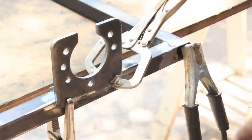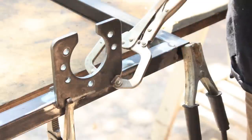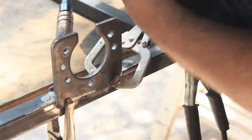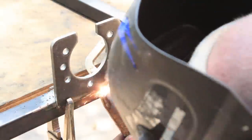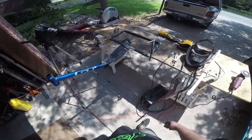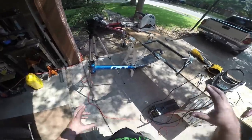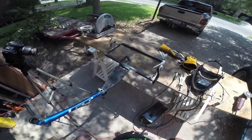Here we have this squared up as best we can with its center line. Because you're looking at something like this, make sure you draw this line across and leave space up here for this nut to sit — otherwise you won't be able to get the bottom bolt in. Now we're just going to tack this bad boy in and that should do it. Got all the surfaces cleaned up, got this straightened out and centered. There's our bicycle frame, there's our axle frame, and now we can tack this bad boy together. The frame will be ready for welding and final prep and we can get back to draining the oil out of that motor and getting the governor out.